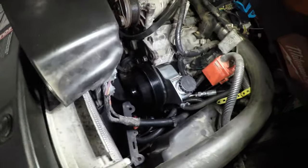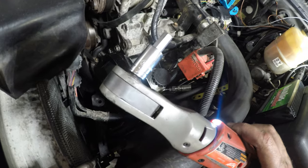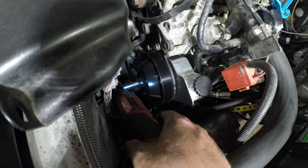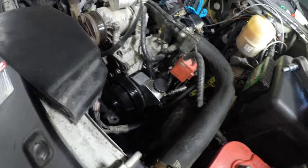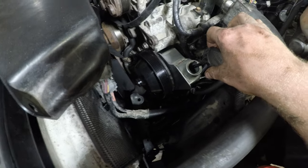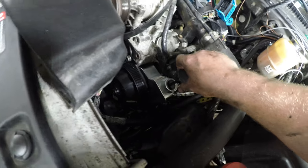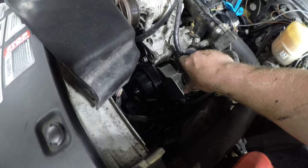As far as priming the system, it's pretty neat that the snout of the power steering pump has a hex key in it. So if you have a battery-powered ratchet and a 3/8 hex, you can actually put the ratchet into the pulley and spin it without having to run the truck. If you do that while a buddy's inside the truck turning the steering wheel and pressing the brakes, you can circulate fluid throughout the system without having to run the engine — and not risk running the pump dry with the engine running either. It seems to work pretty well. The fluid was right up to the brim when we started and it's dropped down about two inches, so that should have gotten most of the air out. We're about to put the charge pipe and belt back on so we can start the engine and get the rest of the system primed.